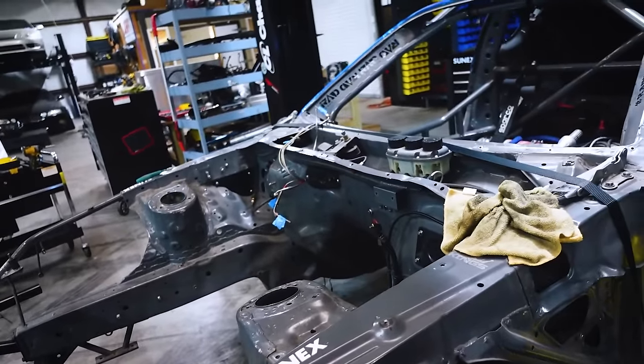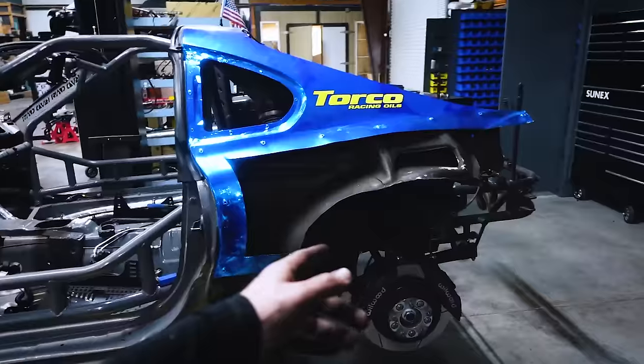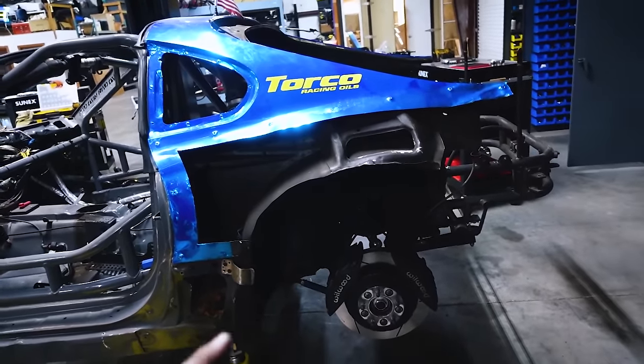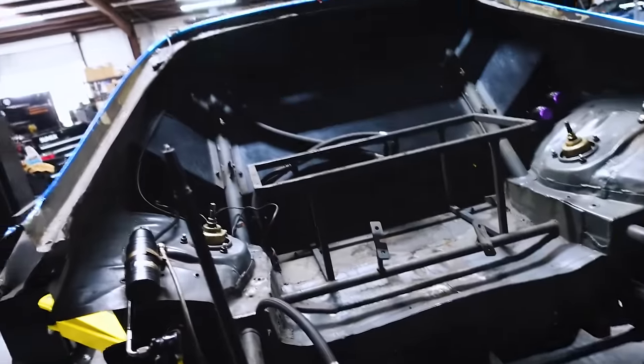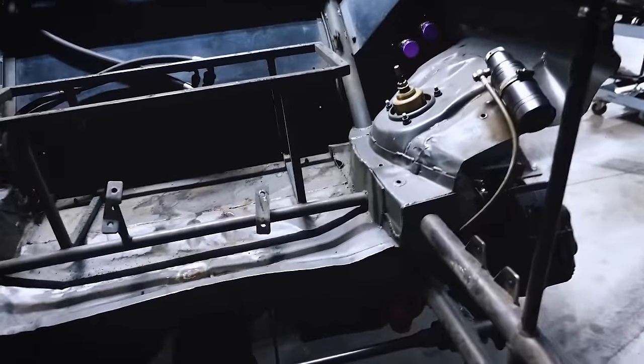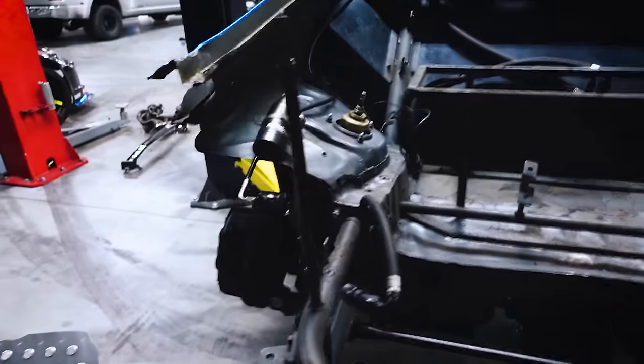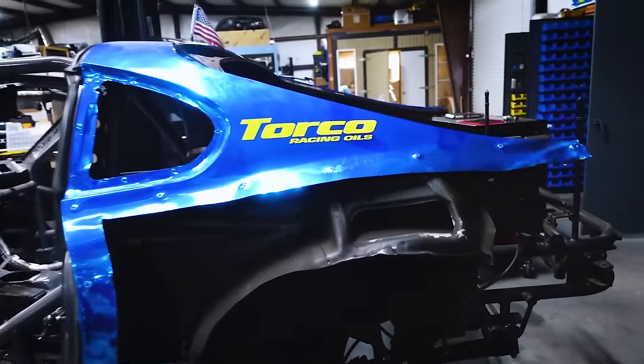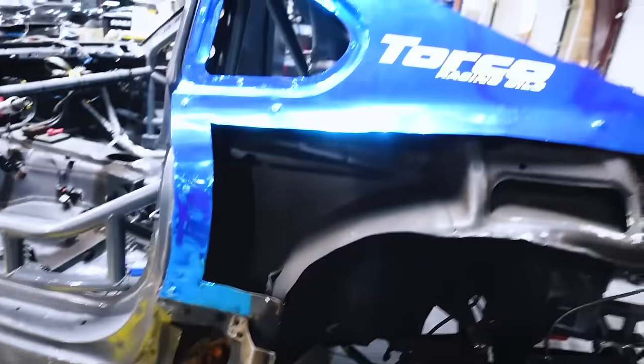The steering column spins back and forth right next to the brake pedal but doesn't interfere with driving. I also have a brake kit that I developed with my machine guy that builds all our billet parts and we just haven't used it yet. I think I'm gonna try and put it on this off-season — the unsprung weight will be reduced because these are pretty big rotors for a drift car, more of a road race style setup. If I could reduce like seven pounds total, might as well do it.